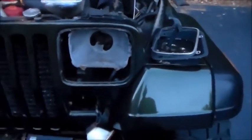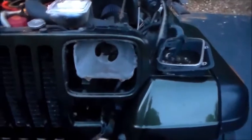So I try this side over here, and the air conditioning is completely killing me on this deal. There's a hose that runs up and down the condenser here that's not on this other side, and it won't fit at all. So I finally removed the headlight, the whole thing, and it will go in this way.